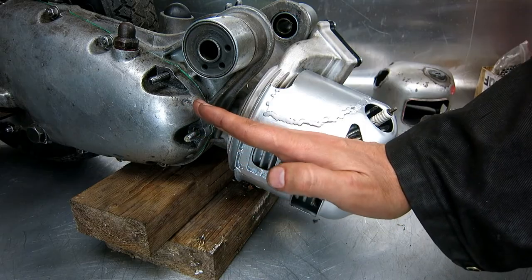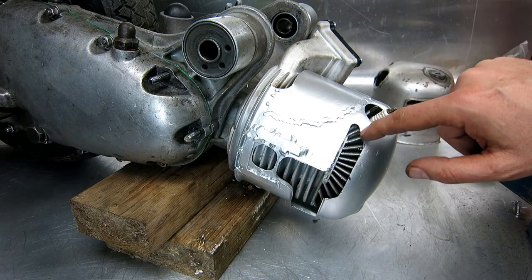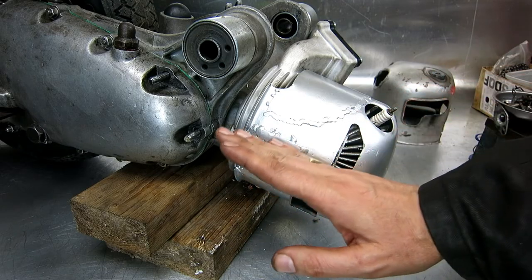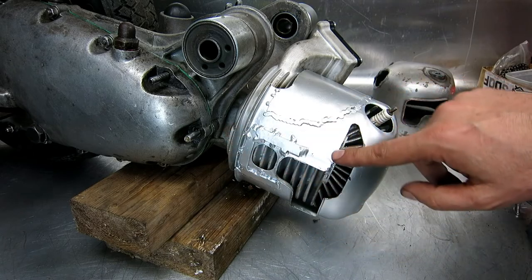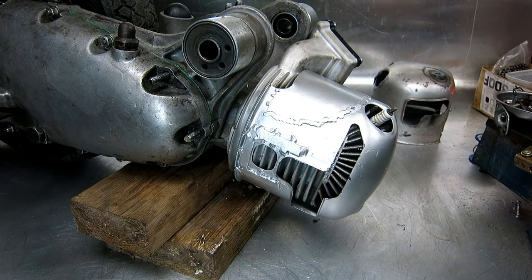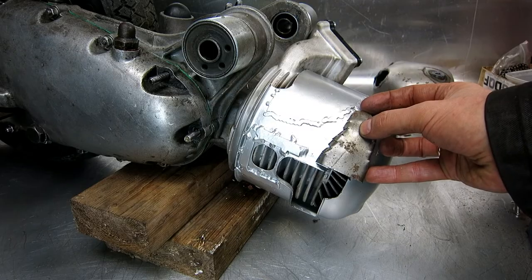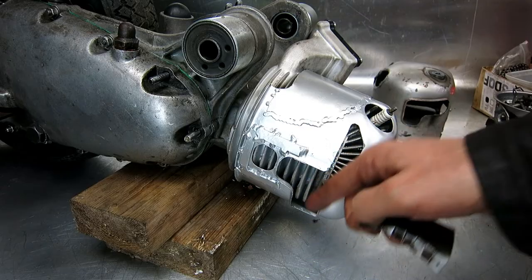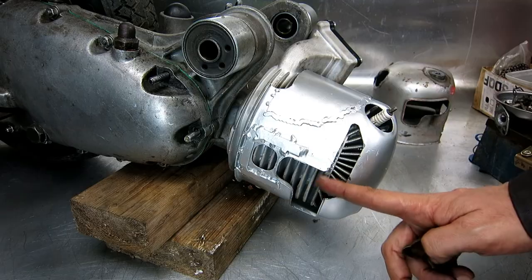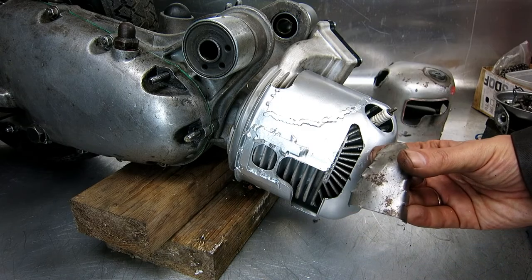All of that is below the line of the running boards. We've also cut a big slot here which you need to let the hot air out. But the problem is as soon as you open that, if the running board area is there, the hot air from here is all going to recirculate back underneath the panels. So we're in the process of fabricating a little section that we're going to weld onto the cowling to vent the hot air down below the runners as per usual - just an ugly little bit of steel that we're cutting and slotting and trying to get bent. It can't stand out too far from here, otherwise it would touch the running boards.